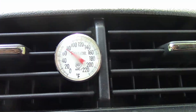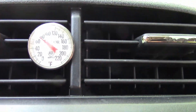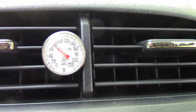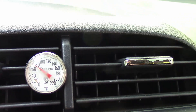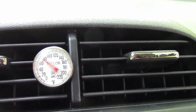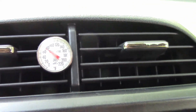I've been running the car on max AC for a while and we seem to be stuck just above 70 degrees — that's the problem. It's very common to typically reach around 40 degrees or a little less or more on a normally operating air conditioning system in a car.